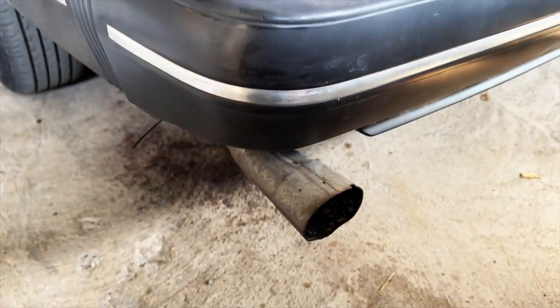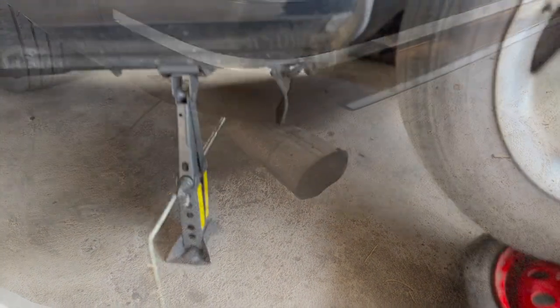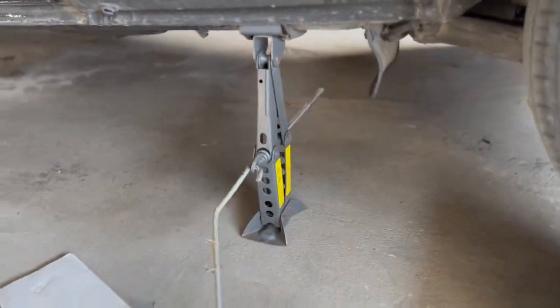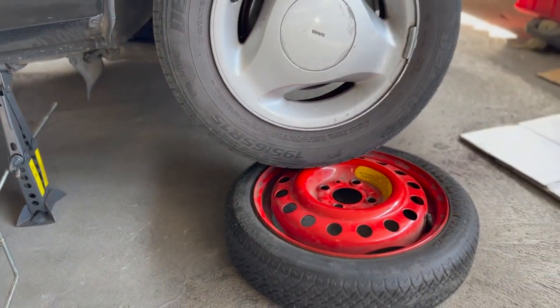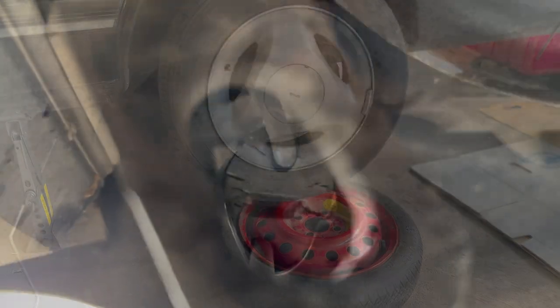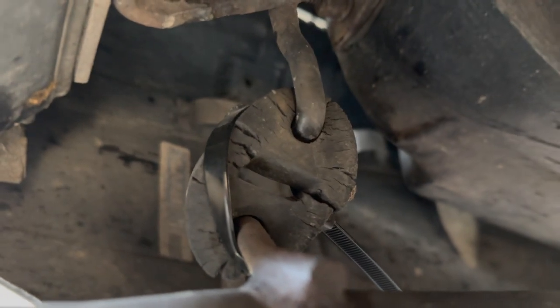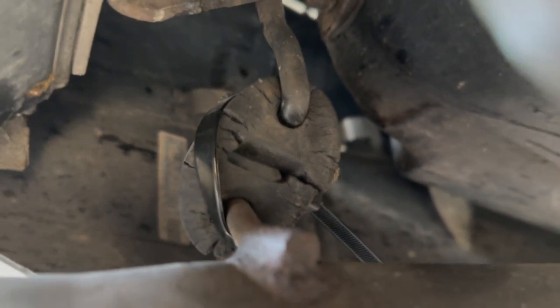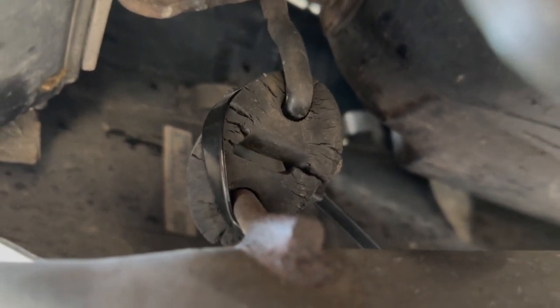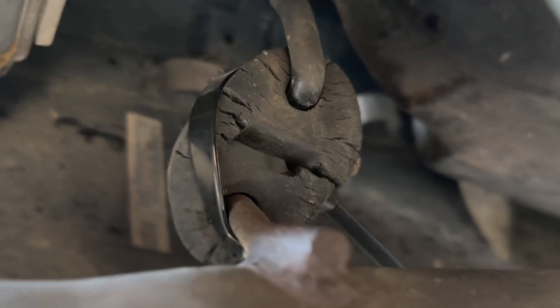One of which is this very obvious loose, moving-around rear part of the exhaust system — I need to get to this now. The first thing to do is get the car up on the jack, and you can see here I've put the spare wheel under the rear wheel just for a bit of extra safety. You can see here the rear rubber mount has become very dry and perished over time, and this has caused the exhaust system to move around. I've used a zip tie just to temporarily hold it in place.